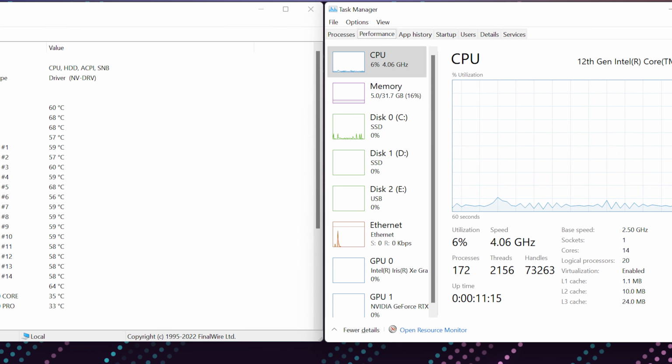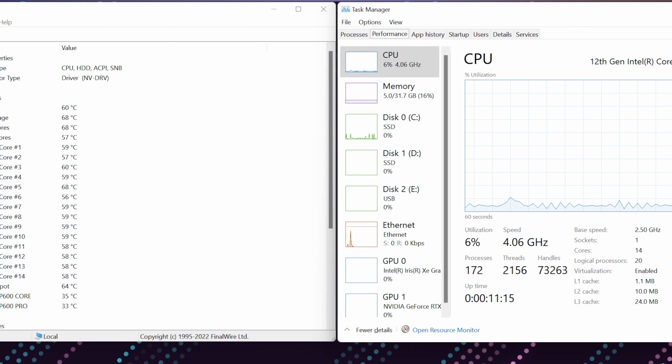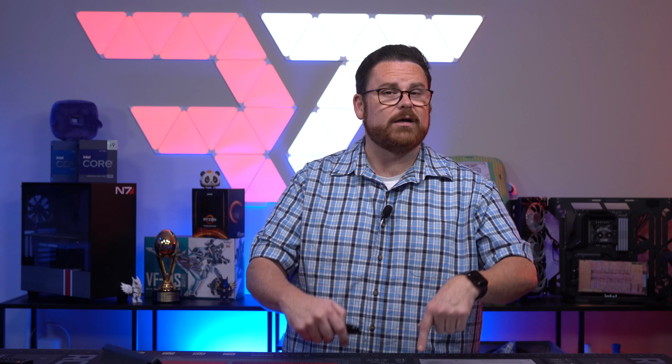Now, before we get into the performance too much, we wanted to state something that kind of hindered the EVO17-S laptops and benchmarks. Right out of the box, we noticed that the system service was running a constant 5% CPU draw if your programs are polling hardware results and stats like FPS, temps, etc. We're not sure if this was a hardware interface issue or not, but here at Robeytech, we always test and review things honestly and openly, regardless of our relationship with a manufacturer. Now, according to them, it appears to be unique to our sample, but we don't have a second one to verify that against, so we're taking them at their word, but we're still gonna tell you about it in our review. So your results when you actually get this, if you wanted to do these, may actually be higher on your own system.